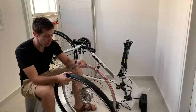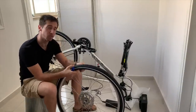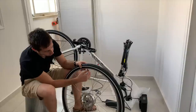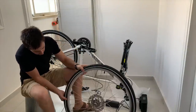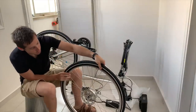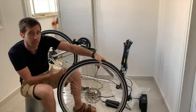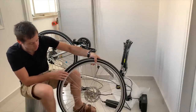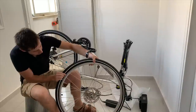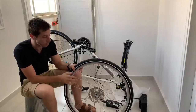I'll check the direction of the tire tread and then seat the first bead of the tire into the center of the rim, followed by the valve stem through the hole. Putting the cap back on the valve stem helps keep it from moving around. Then go around and seat the bead — it starts easy but becomes progressively more difficult as you stretch the tire. If you can get it over with your fingers, that's best to avoid popping the tube. If it's too tight, use tire levers to lift the bead over the rim edge. From here just pump the tire back up.